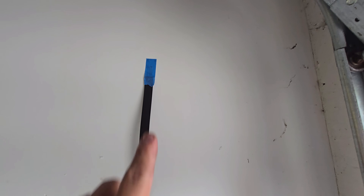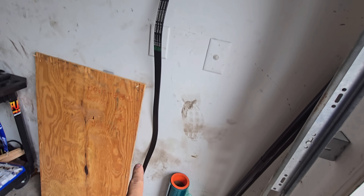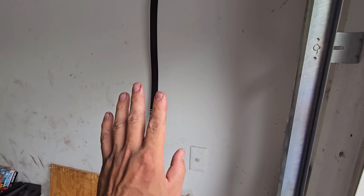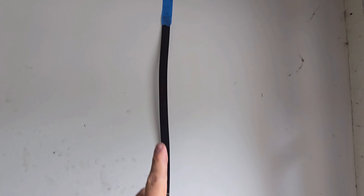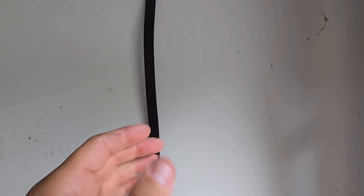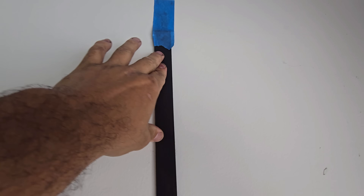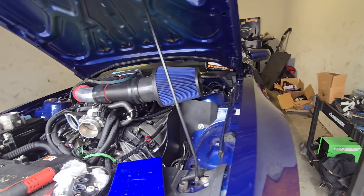What I did is I took a belt, routed it, put a piece of tape, and cut it right in the middle where it had no tension. The total length came out to 75 inches. So I'm going to try a 74-inch belt and a 73.5-inch six-rib belt and see how close I am. It's one of those things where you have to go back and forth a bunch of times because you don't know how much tension the tensioner has — not the most scientific way, but that's how I do it.